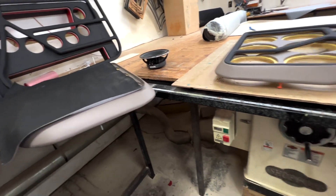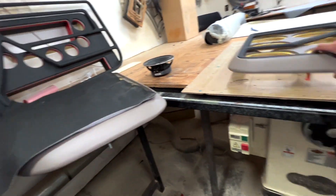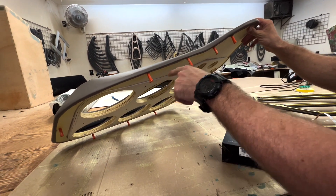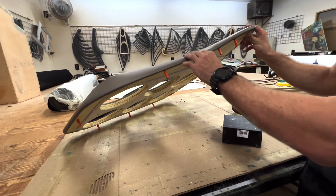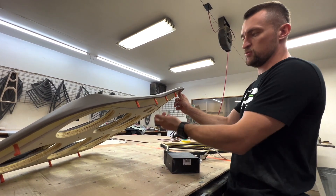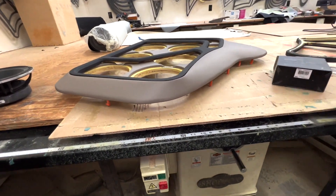Here's the back side door — beautiful. This is another back side door, and this is what we use for the trim. This is how they bolt to the door. Before using glue or anything, we use tape to protect the tray, because when you work with fiberglass resin the tray won't be as good otherwise. Pick off the tape and it'll be like new — some small tricks that save a lot of time.